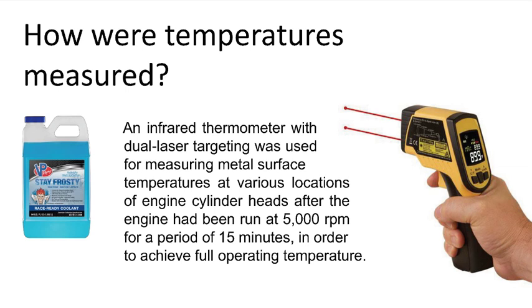We went ahead and compared different operating temperatures, and we took 2 test subjects. One was a conventional 50-50 mix, and then we took a waterless coolant, which is pretty popular right now in the industry. And just so you guys know, waterless coolant equals 100% glycol type product. So that's chock full of glycols. You're not going to find water in it. That's why a lot of them say do not mix with anything except for the product particularly.